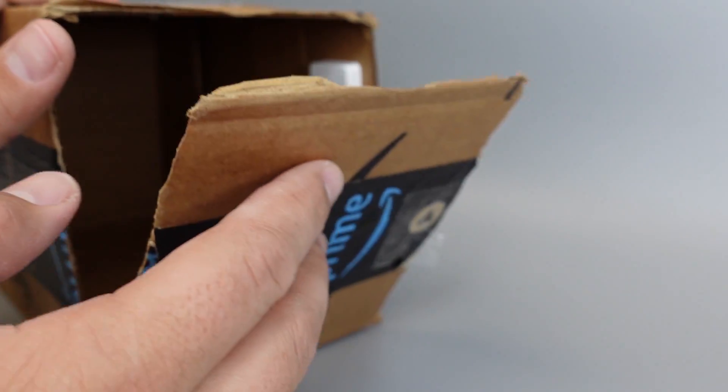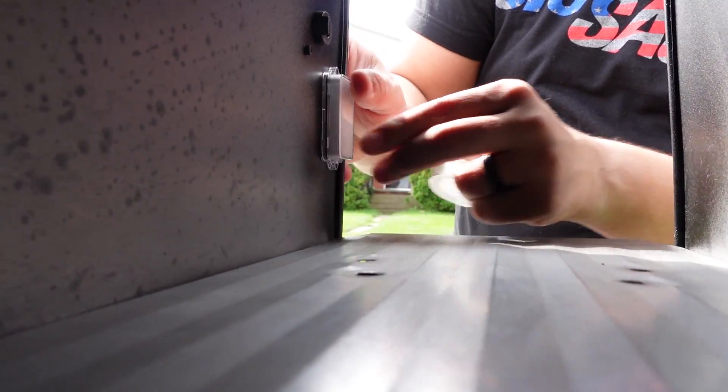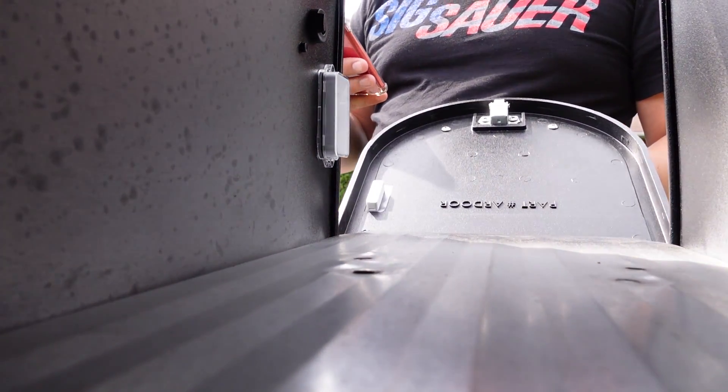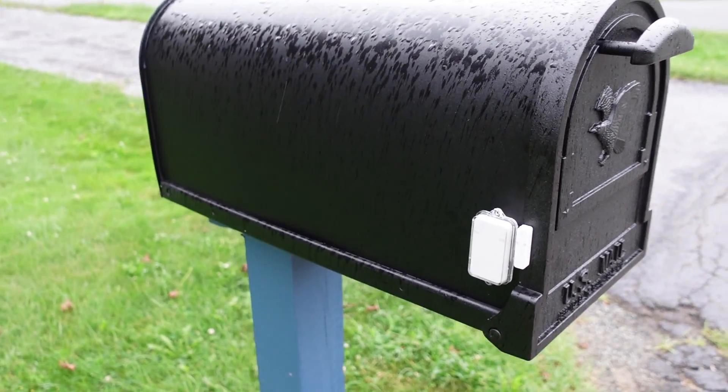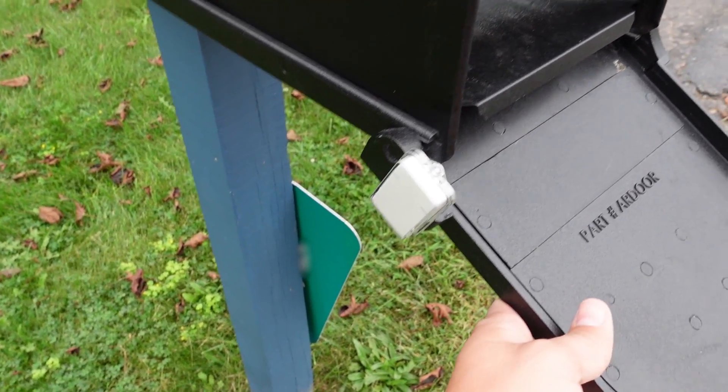Next I did some planning on where to mount the sensor on the mailbox. After testing on a cardboard box I proceeded to install the sensor on the inside of the mailbox — but as soon as I put it inside, it stopped communicating with my Z-Wave network. I tried mounting it underneath the mailbox — no signal. On the side of the mailbox — still no signal. After trying all different locations I found that having the sensor inside or directly mounted to the big metal box was interfering with Z-Wave communication.